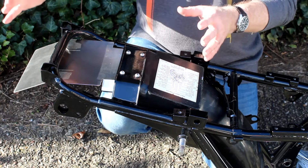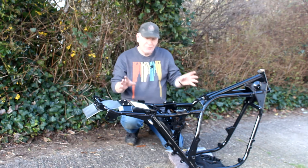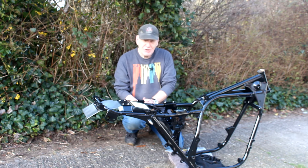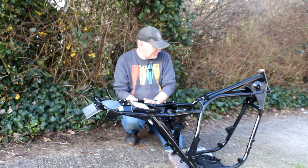Moving on to the front of the bike: we've made this steel piece that we welded and bolts to the front of the frame. This tube slides over the original steering lock. We've done that because when we fit the R6 yokes, the original steering lock is too much for the bike. With this bolted into place, that fatter piece gives the steering lock the correct amount of travel when using the R6 front end. I can't touch it yet because it's still drying. This is about as far as I can get for this week. For the next video, we'll hopefully have this as a running chassis — I'm going to work on the front end, yokes, forks, wheels, the swing arm, and the rear end. Now I've got the engine cases back, I can also start to rebuild the engine. All of that will be for the next video, so thanks for watching — cheers.